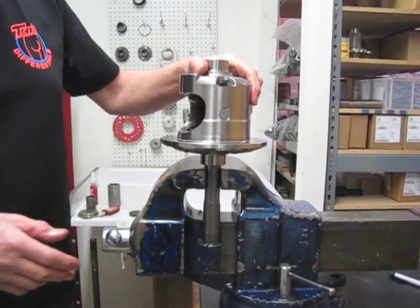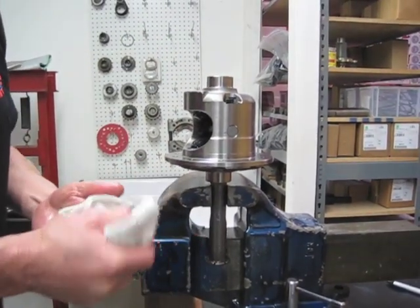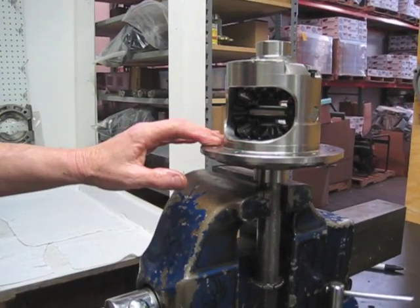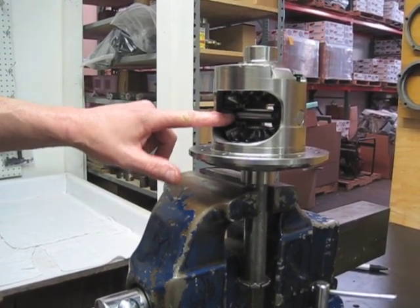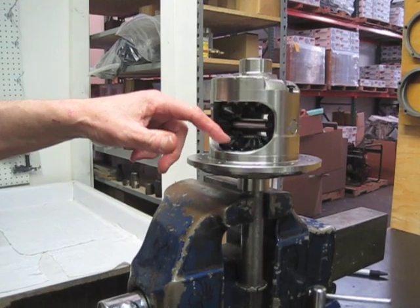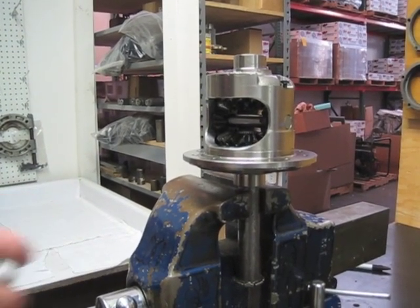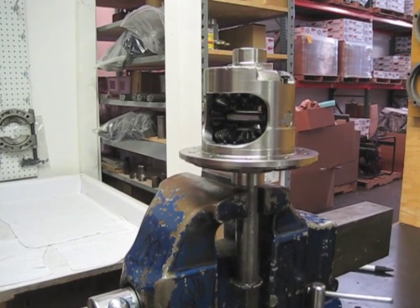Okay? As far as backlash, you hear this backlash all the time. Oh, how much backlash should I have? There is no backlash in there. That's the idea of tuning it. What you do by tuning it, by adding additional shims here, when your Posi is connected to your ring gear, when the pinion turns the ring gear, the only thing connected to the ring gear is the Posi case. All the power flows through the cross shaft into the pinion gears. Pinion gears, by natural gear force, push the side gear away and compress the clutch. By adding extra shim, you've moved the side gear closer to the pinions so that when you nail it, that side gear doesn't have to travel as far to lock it up, so you get a much quicker lockup. At the same time, when it's closer to the two gears, you have more gear tooth contact, so it's indeed stronger. Correct? Piece of cake.